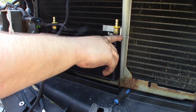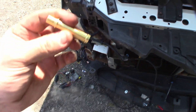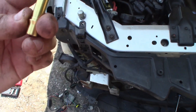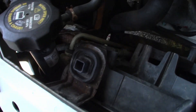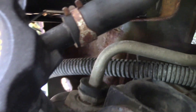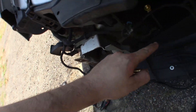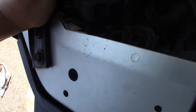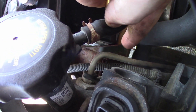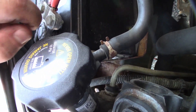It's fully installed. I have the ear over here and that is pretty solid. Next, we're going to install this tiny little piece of brass — all it does is convert the factory cooler return line right there into a barb, and then we can hook the tubing up to it, snake it through here down to the cooler. The return on the auxiliary cooler will go back into this original line here — we can just flex that a little bit over to the side and that'll work.